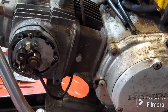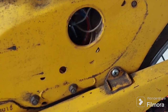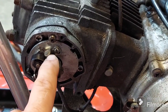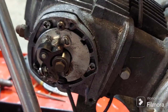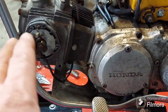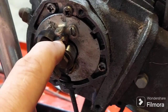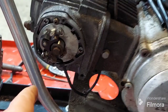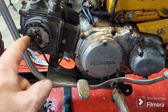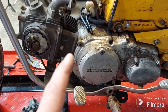That confirms my theory about dirty connections. I need to get in here and clean all that up so we have great contact. We've got power to the points and when they open and close it sparks, so we just need to clean and reset everything. I'm going to start from the beginning and set static timing correctly. The points are probably dirty or the gap isn't set right. Instead of just trying to fix one thing, I'll reset all the timing from scratch to make sure it's 100 percent. Get that carb kit in and this thing is going to run.